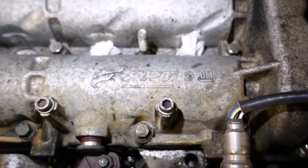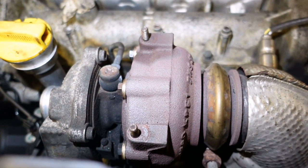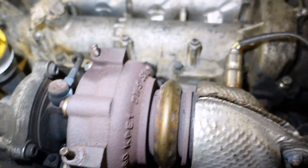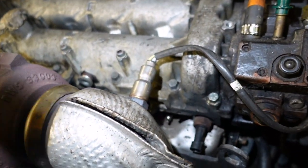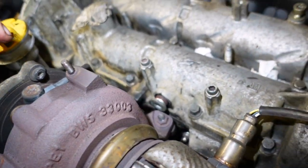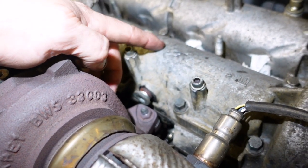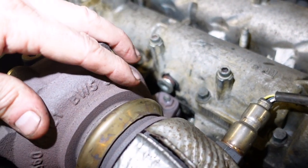This particular one is a wee bit different. Sometimes you won't see the turbo sitting looking at you just there. On the older ones, the turbo is down lower and that turbo isn't there. I mentioned in part one that to get the locking tool into this camshaft, you need to take this turbo off.